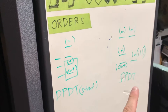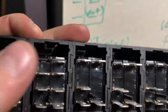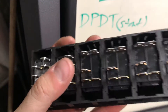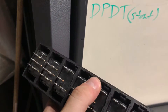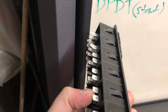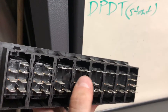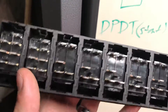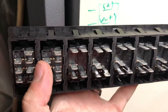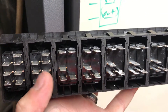I'll get a quick diagram on the board just so when I'm wiring this I can always kind of see. It's actually really simple. When you hold it like this, all the top pins are grounds — so for these two switches, the ground for the LEDs. And then these are the grounds for both the LEDs. And then on this one, the center, this guy is always power — dead center here. And then these ones just have two powers because essentially these ones are meant for motors. So you have two power wires come in, and then on one side you have them normal, and the other side you have them crisscross, so that way you can reverse a motor.